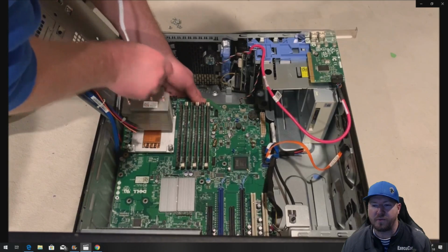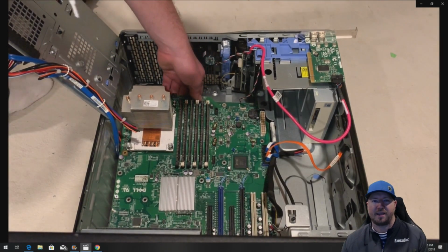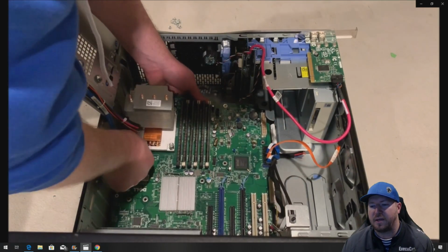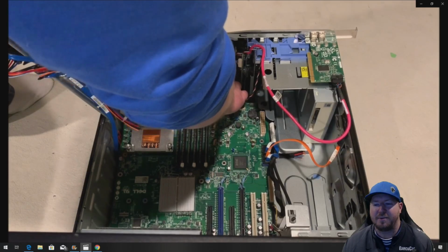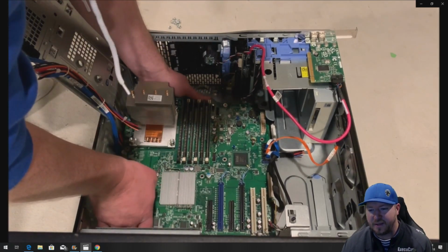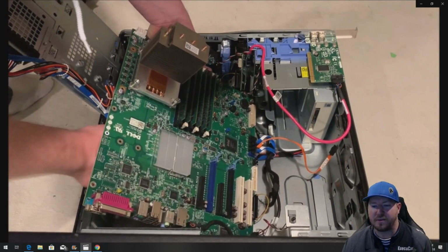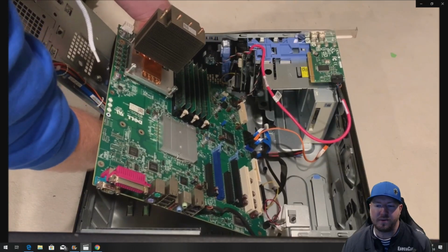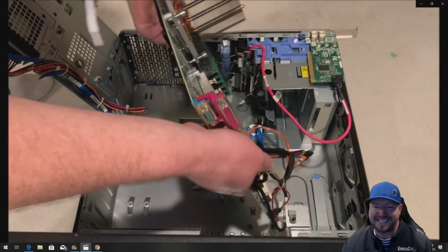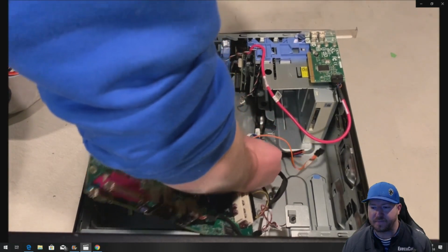All right, so we have removed all the screws. We're just going to gently remove that blue cable harness, the blue and white one. And see, we're trying to pull the other one out, but as you're going to see, it is zip tied underneath the motherboard. So we're going to give you a little angle at that. So gently remove this motherboard, and we'll prop it up so you can see the little black zip ties that are underneath there.